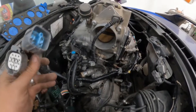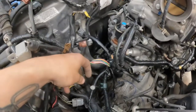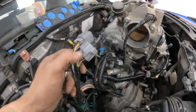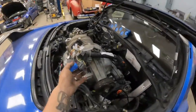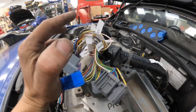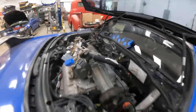Now this part of the harness would have gone to your factory chassis harness — probably like these ones here. I've got to figure out how to wire these: powers, grounds, send signals to the gauge cluster, all that good stuff. Other than that it's really just a matter of de-pinning and re-pinning this guy over here. These three plug in no problem. These ones we've got to do a little wiring on ourselves to get them figured out. And then these will go to another plug that connects to the ECU — all pretty straightforward.